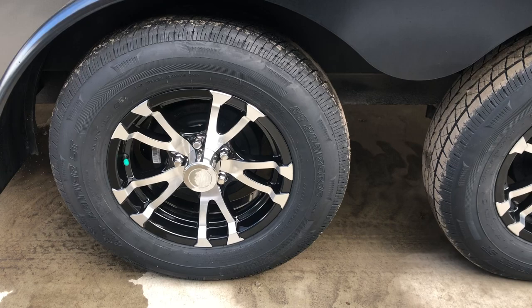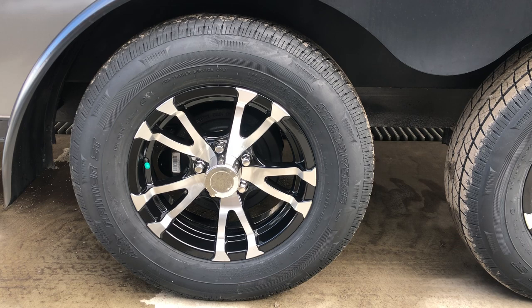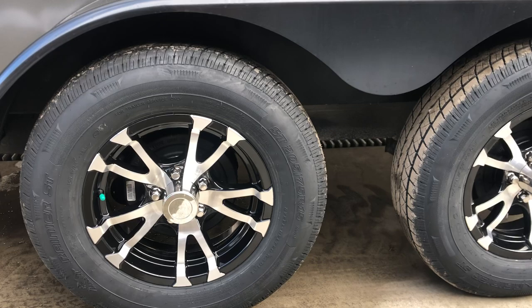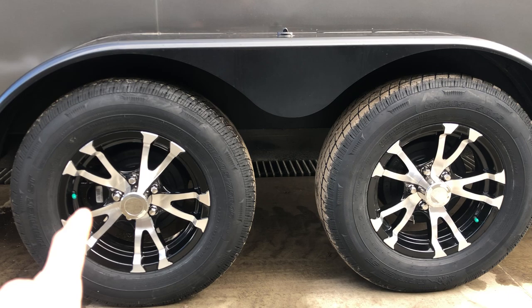This does have the newer style forward-adjusting brakes, very similar to a car setup. The brakes will self-clearance with your forward adjuster. It also has the newer style easy lube hub — behind the center cap you can take a flat-bladed screwdriver, peel a little black cap off, and there's a grease zert behind it. You can do your own bearing maintenance fairly simply. Notice the green cap — it is a nitrogen-filled tire. If you're not familiar with nitrogen, it's very stable. They say it helps the tire not dry rot from the inside, as some would with traditional air. That's a slower process but again it is a nitrogen-filled tire.